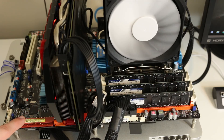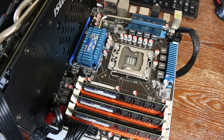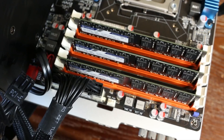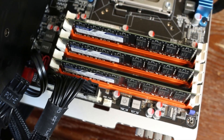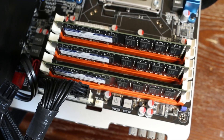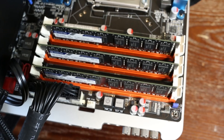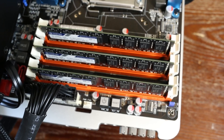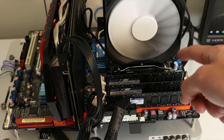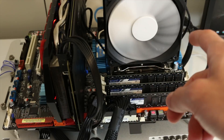Here is the actual platform. For the motherboard we have an ASUS P6T x58 motherboard. The nice thing about x58, at least from the end-user perspective, is the triple-channel memory instead of just dual-channel. I actually have three sticks at eight gigabytes apiece for 24 gigabytes of DDR3 RAM, and this is overclocked — this is that Time Tech RAM — running at over 2,000 megahertz on this platform.